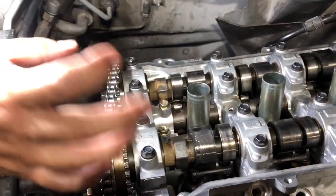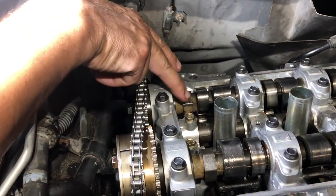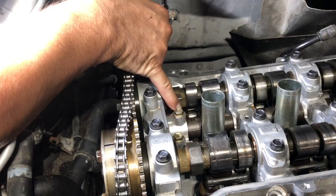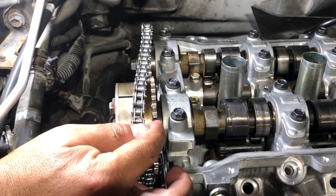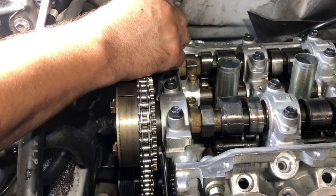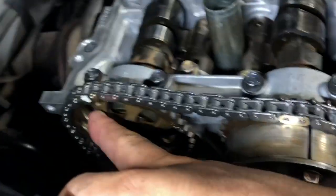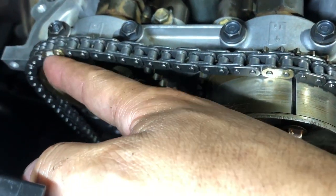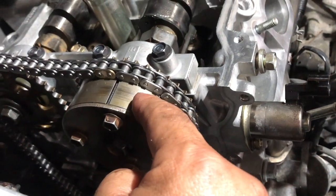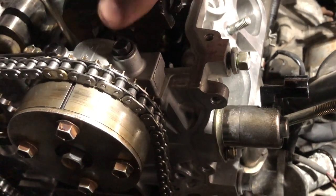What I really needed instead of a crescent wrench was an open box wrench. However, I don't have a size that fits because it's hitting this piece. So I have to remove the chain again off the intake side of this camshaft sprocket and move the chain just one tooth back so that the exhaust sprocket's dimple is aligned to this gold chain link. Now I'll adjust the intake side because I have room and real estate to use this crescent wrench and adjust accordingly.